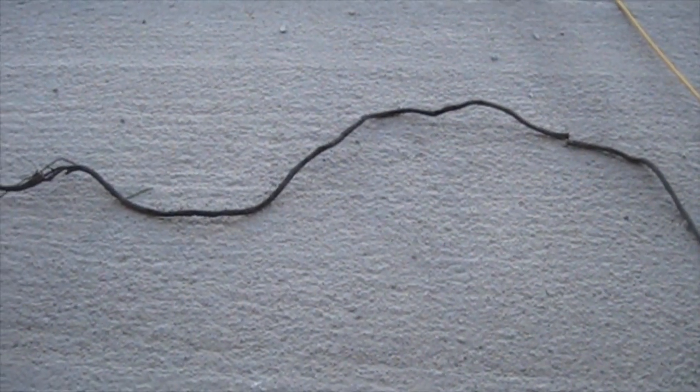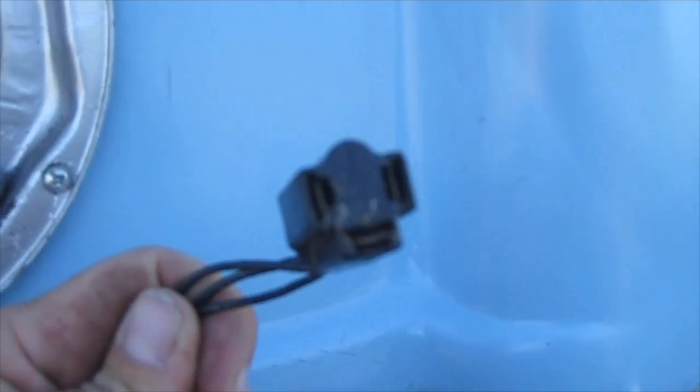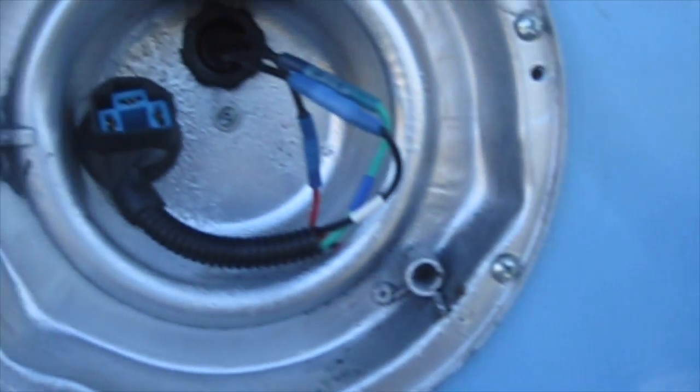Here's what's left of the right-hand side of the headlight harness. I did cut it in a few places to help with removal, but otherwise it's still in pretty rough shape, so I am going to replace the whole thing. When I started removing lights I did label the wires, but since I'm rewiring the whole thing it'll just be easier anyway. I only stock two colors of wire on the farm: black for positive and white for negative and for grounds. I use colored electrical tape to identify individual wire purposes — each wire is marked on each end with the same color. My old headlight plug was bad, so time for a new one.